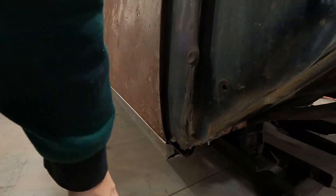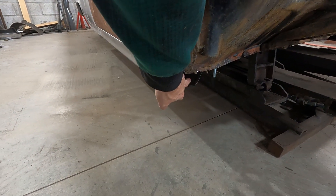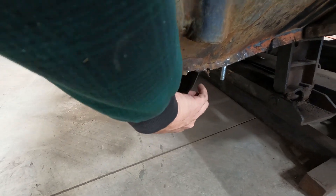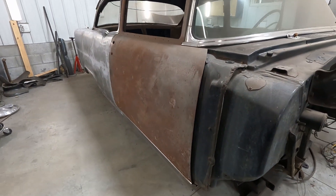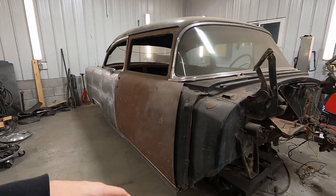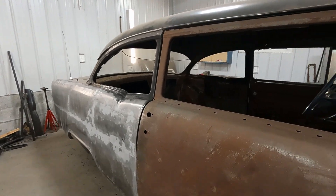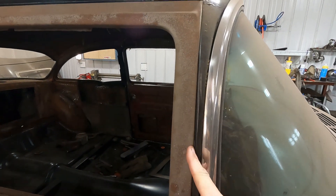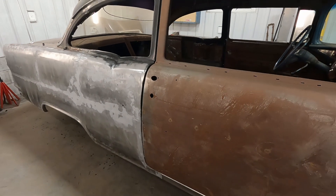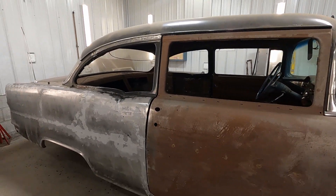Both sides have new rockers, but this side is open on the front. I need to make the pieces that go in here. My rocker and my inner rocker are not clamped or welded together, so that's one of the things I wanted to do while the body is off the chassis. It's tacked in spots but I need to clamp and weld it all the way across. This side looks better than the other side — there's a gap here that's super tight, actually overlapping in spots, so I have to play with all that.